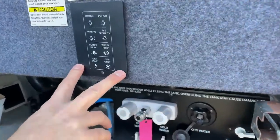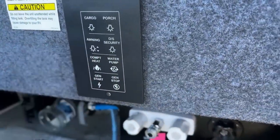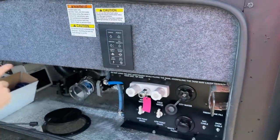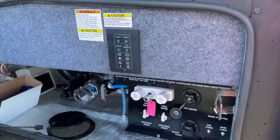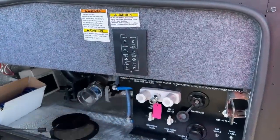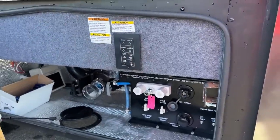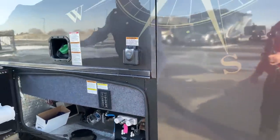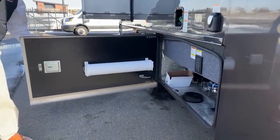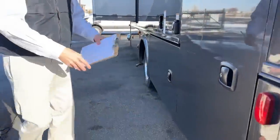Notice here you've got a Firefly multiplex panel. What's nice about that is you can actually turn the awning lights on, cargo lights, porch lights. You can turn on this heater from here, hit the water pump — say you want to winterize the coach. You can start the generator and stop it from here, which is just really, really neat. As well, you can put this whole system on a phone app. You have a nice little sewer hose compartment right there. These are all aluminum doors and they've got slam latches on them. Just a super cool little unit.